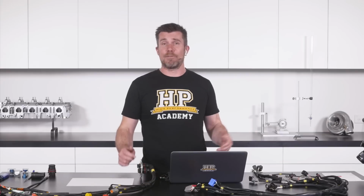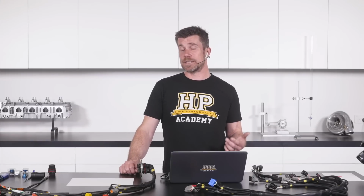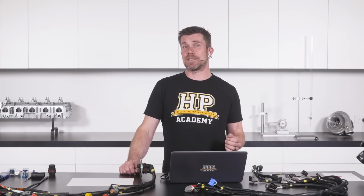When you get into 6th gear, the vibration in the car is so bad that it's difficult to see out of the rear view mirror, which is not that helpful when you've got GT3 race cars coming up behind you at high speed. And it's also not really that good for the components in the car. So far, we've had that high-speed vibration cause a power feed off our alternator to fracture. We've also had the bracket for our alternator fracture, and we sheared through a bolt on the front of the drive shaft at our last race.